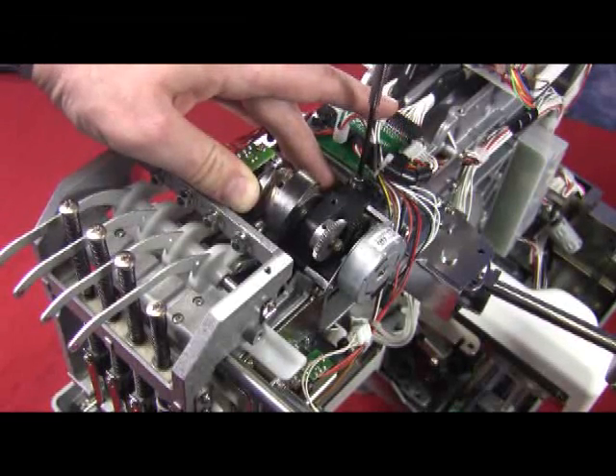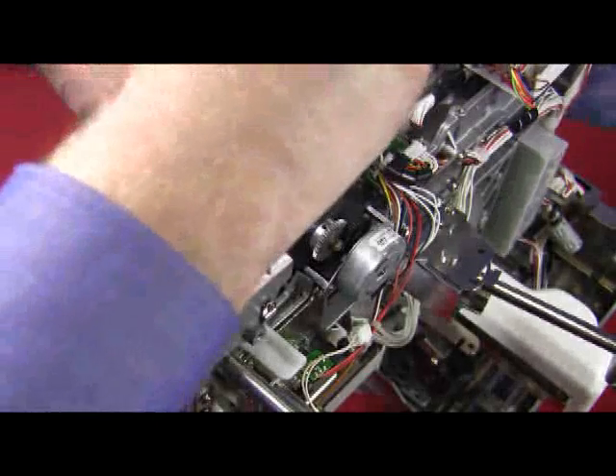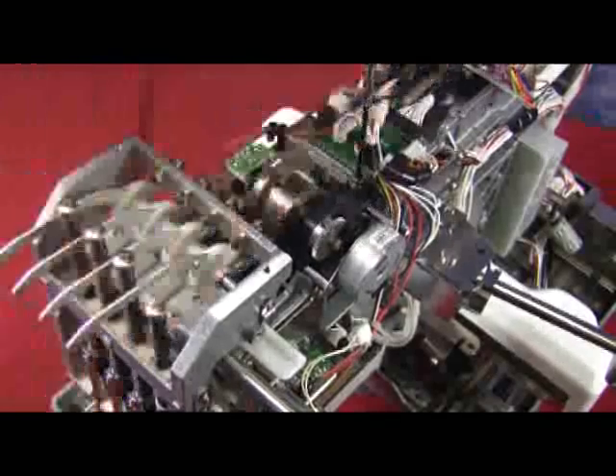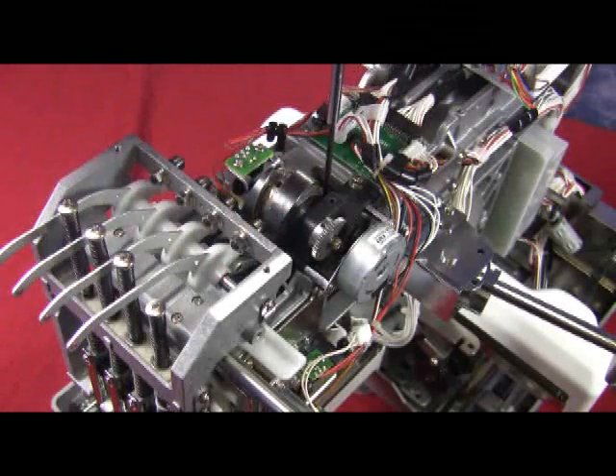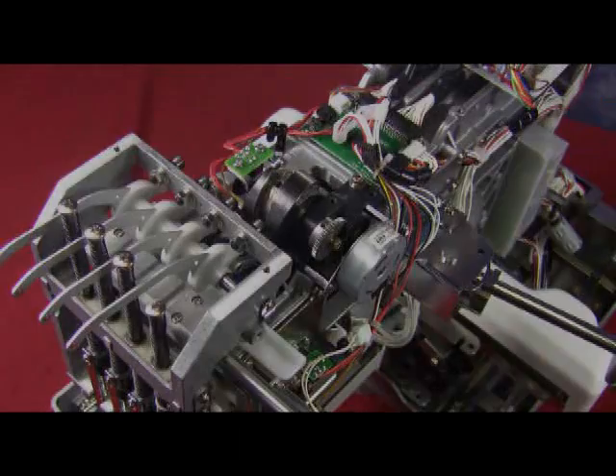Remember, it's very important to make sure that the cam has one screw facing up and the other screw facing the head roller pin. This is how the machine knows that it's supposed to be in center position. And if you have these screws facing the right way, you can center it easily.